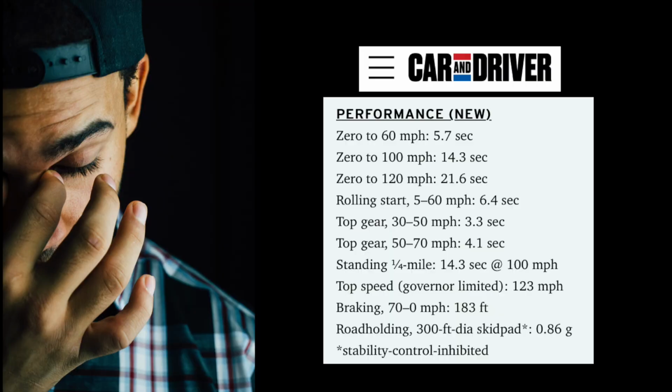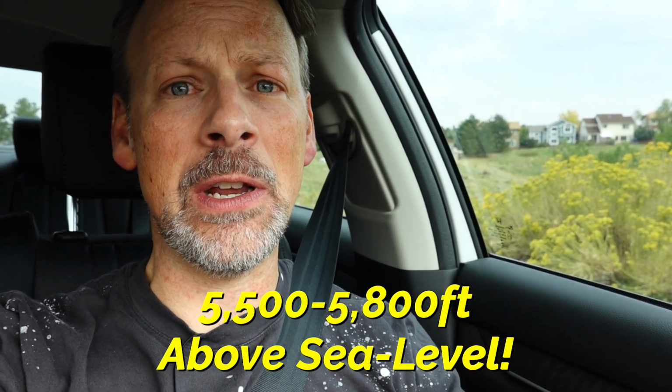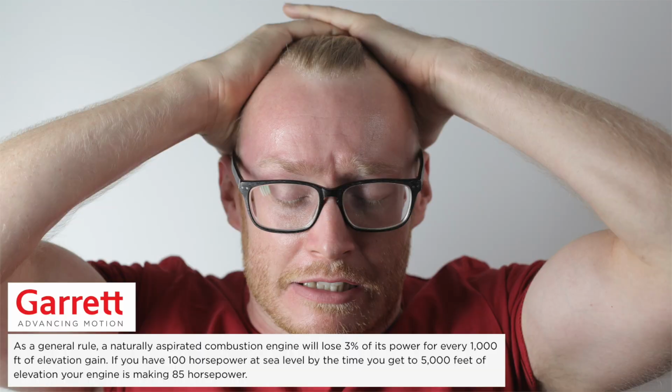Those of you new to the channel and you're watching this and you're seeing the 0 to 60 numbers and you're scratching your head and you're like, what the hell's going on? These numbers are crazy. They're slower than the stock numbers and he's modified. I'm at altitude. I am at 6,000 feet above sea level. I'm in Denver, Colorado. The air is thinner. You don't have as much oxygen. Cars lose as much as 20% of their horsepower at altitude. Now, if you're looking at the dyno videos, know that the dyno is standardized, so you can compare those across the country. But from a 0 to 60 standpoint, I'm not converting it. This is what we got. Yes, it's slow up here.